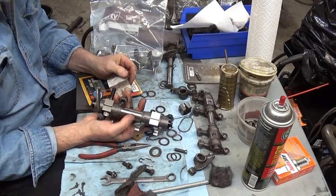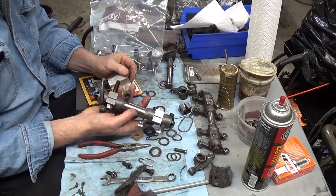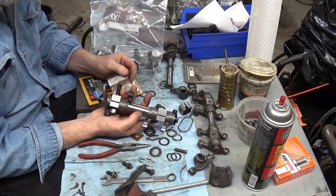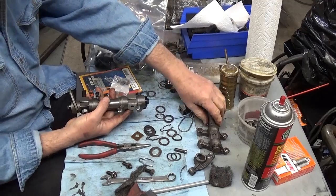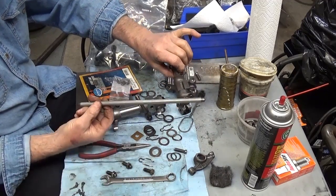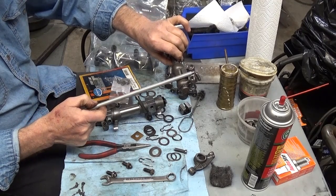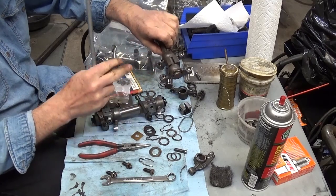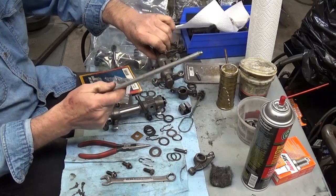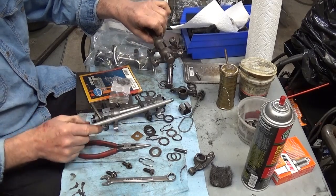Now, I've used ratio rockers before. It's more expensive than just buying a performance cam. The advantage of doing this on a stock engine is I could run stock aluminum push rods and a stock rocker arm assembly. I'd want the solid shafts. I wouldn't want these springs. I would want heavy ones. You always have to increase your spring pressure when you use these type of setups.